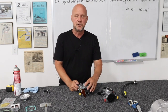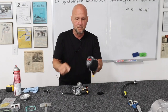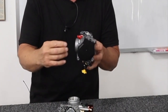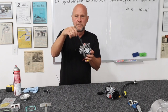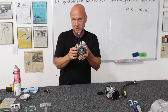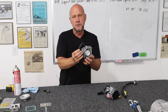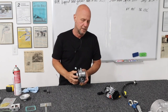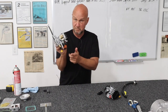The other thing that got changed was I made these FlexiJets, because this stuff is hard to get to. On the new frames — whether it's the two-strokes or the four-strokes — to get your fingers in there to change the idle jet, it's not that easy. The FlexiJet actually works on all bikes 2017 and newer with this newer-style throttle body. It's great for the new-style frames. Yes, if you turn it too far it's still going to be hard to turn, but it's still easier than trying to get to that. For a small price, this might help you out.